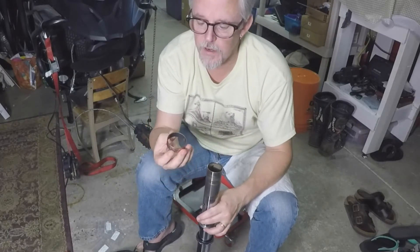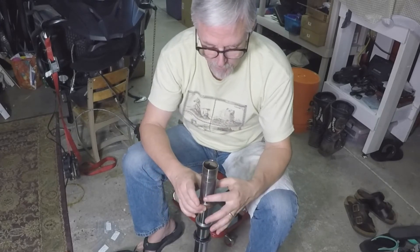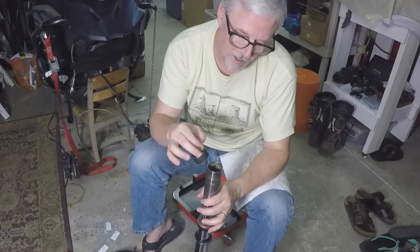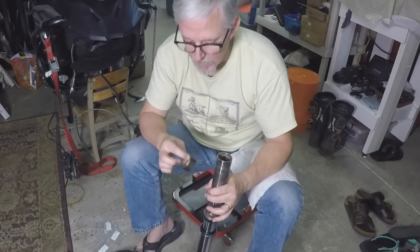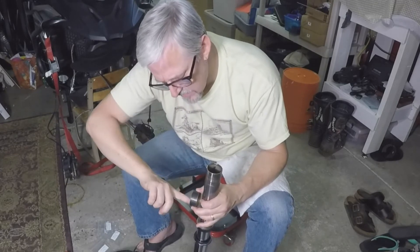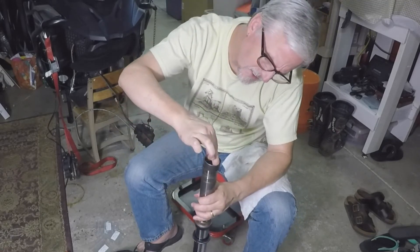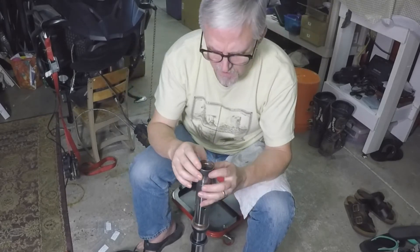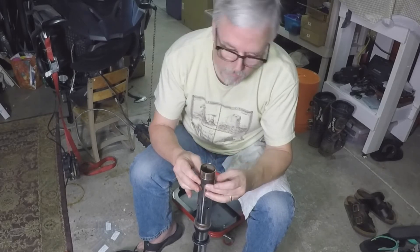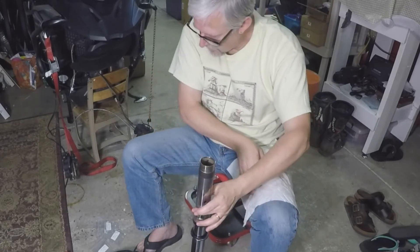Now it's time for the bushings. We've got a rather large bushing that fits nicely and easily over the sliding tube — let's put that one on. And then for the one that's tighter and has the split in it, that's going to reside in this slot. We're going to put a little bit of oil on the inside of this guy before we install it. Now we can spread it as we put it on, and it snaps into place quite positively. And that's it.